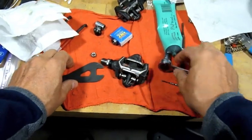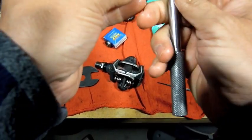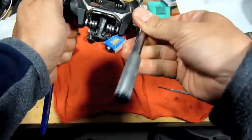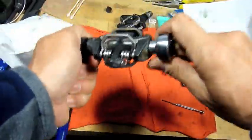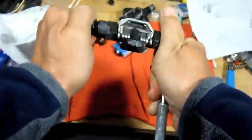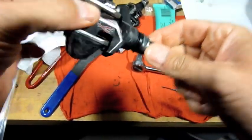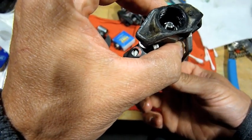Get your wrench, 10mm socket. And get that started on there. And then seat the bearing. Alright, stopped. Check the play. Very, very smooth. There is some play, a little bit. It's supposed to be there, but this has set itself all the way into the stop. Alright. And it's running smoothly.